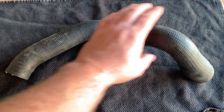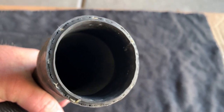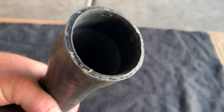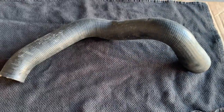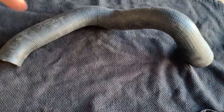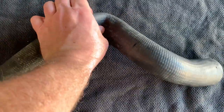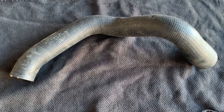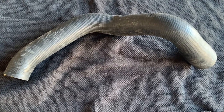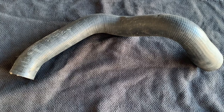When you pull this tube off, you can physically see inside — you will see the spring inside this tube. This one obviously doesn't have a spring since it is not the spring-actuated tube. If you can kink your hose like this, you know you don't have the spring inside there. This is one of the seven deadliest sins of overheating a Jeep XJ. Real easy to install and replace — just two clamps on each end.